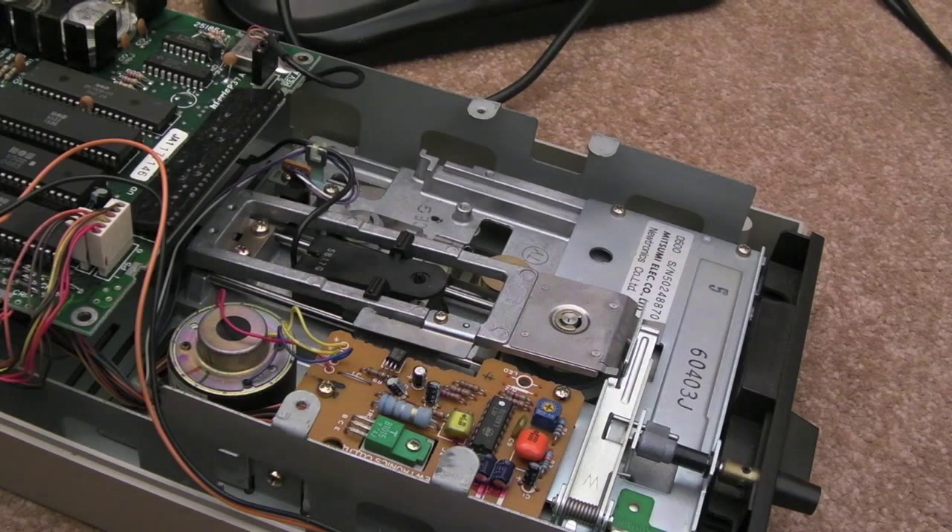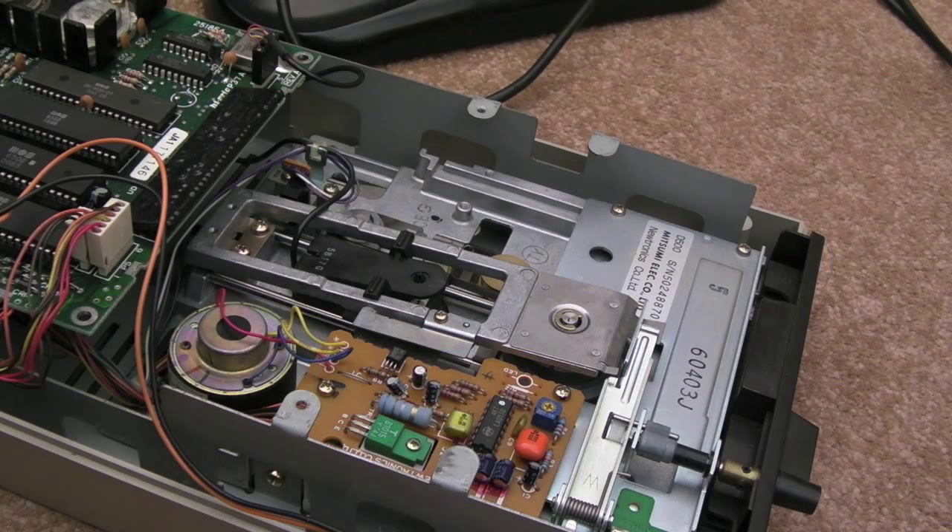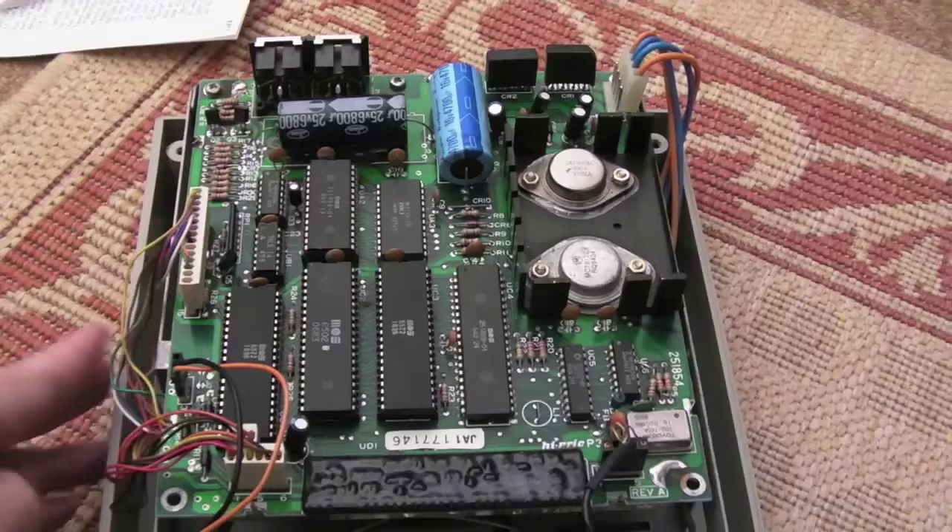At the end of the day, the heads were not only clogged — it needed demagnetizing, and that was the key. Until I demagnetized it, it was doing absolutely nothing. And then finally a really thorough general cleanup. There's nothing really wrong with this drive — it's amazing really.